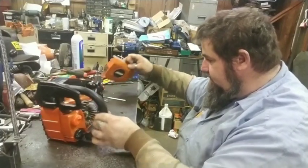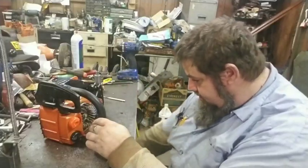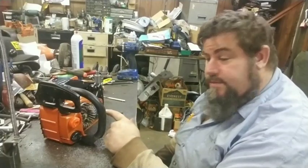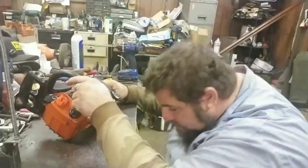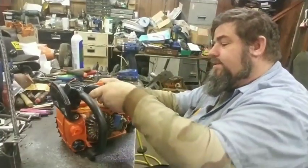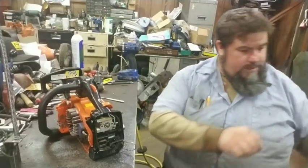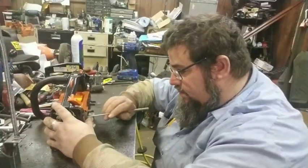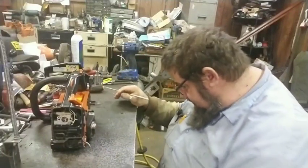Put the pieces down here in the box, put the screws over here in this box. And if I ain't mistaken, y'all remember, the last two of these we did, they have bushings underneath the coil, and they do. There's plastic bushings underneath the coil, so you gotta be mindful of that whenever you pull it down. If you lose them little plastic bushings, your coil won't be in the right place when you put it back on there,